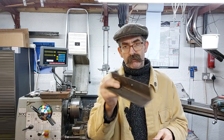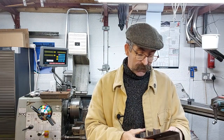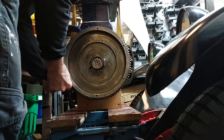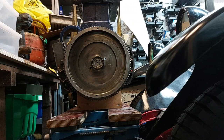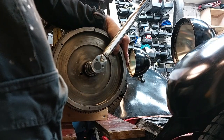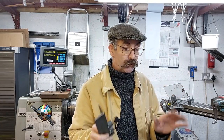It's just a tool to do a job, so probably hopefully only use it the once, but yeah, handy nevertheless. So as you'll see, that worked really well. So bolt it on, position it against the flywheel nice and tight, and that allowed me to gently torque the nut down, allowed me to tighten it down to its specified torque settings. And so that's done. As you can see, flywheel's on.